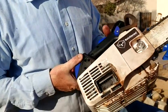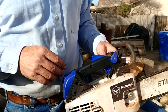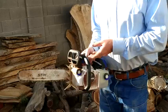It's smoking a lot. That's a 40-to-1 mix that I put in there. And I don't know if it's just because of the manufacturing, when they run it, it's pretty rich from the factory. So there's some residue in there. A couple things I would recommend on this is be prepared to kind of finagle, figure out how it's going to pinch your chain, if it is at all. The main issue that I've seen is the clutch cover and how that goes on. So make sure that it lines up with your chain properly.